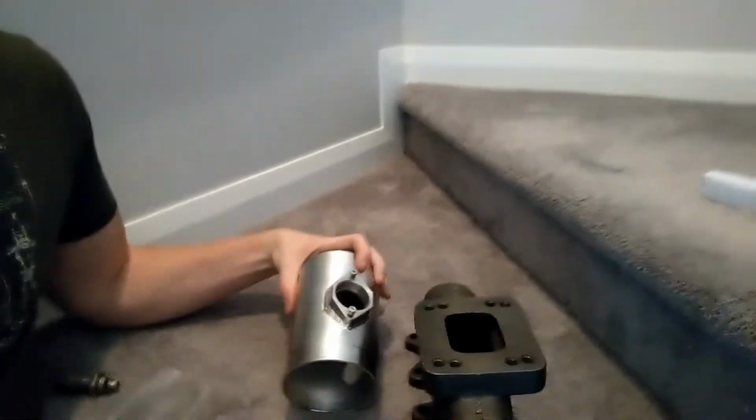Now we get on to some of the more interesting things for the Beetle anyway. This is for the VR6 that I have. This right here is probably my most interesting part. It is the manual tensioner for the VR6. It does come with a manual tensioner for one of the chain guides, but the other one is oil pressure. It's got an oil pressure tensioner, I guess you would call it, and this just replaces that. If the car's been sitting a long time, if that tensioner messes up, if the pressure doesn't get to where it needs to be in time, that chain becomes untensioned, and then it tends to eat valves and/or pistons with the valves. So this was pretty expensive, and it's a fully machined piece. But it's really cool, and it's really important to a reliable VR6, I think anyway. You can do it without these, but this just makes it nicer.